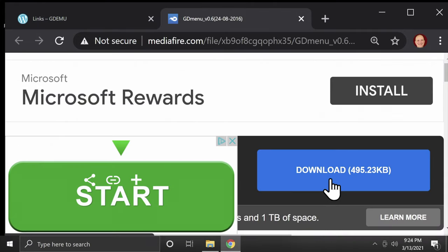Put the SD card you intend to use with your GDEMU into your computer. You'll need to identify the drive letter for the SD card, and you don't want to get this wrong. Go to This PC and hover over the various drive letters until you identify the correct one. In this case, I'm using that 128GB card and it's going to be under Drive G — but make sure to select the correct drive letter for your own computer. Navigate to the Downloads folder and you'll have two things there: the GDEMU in zip format and GUI Format. I recommend running GUI Format as administrator if you have administrative access to the machine; if not, you should be okay.